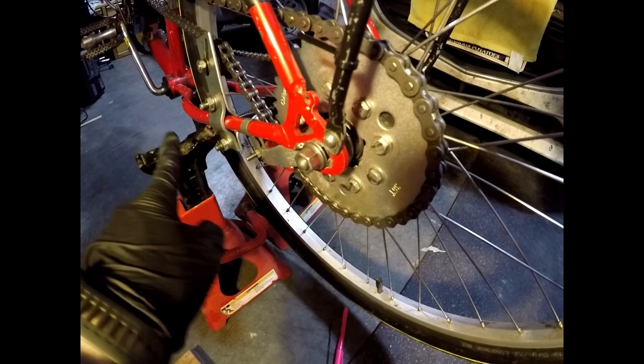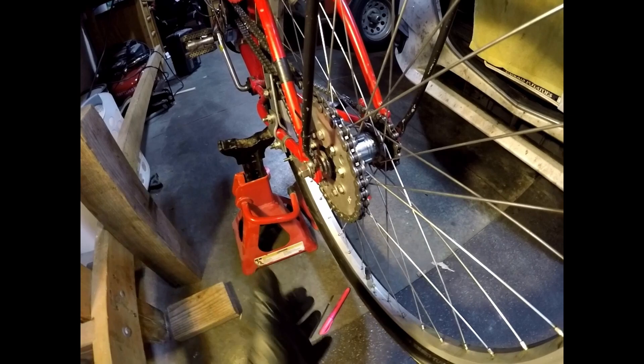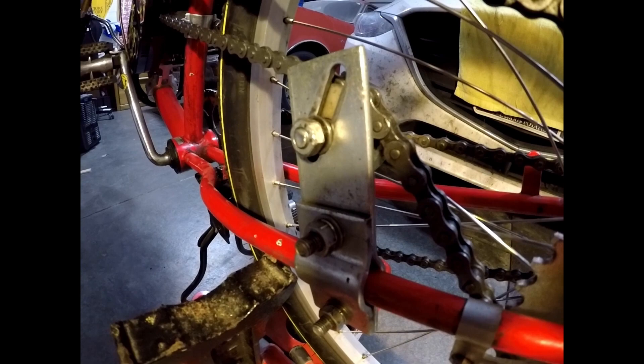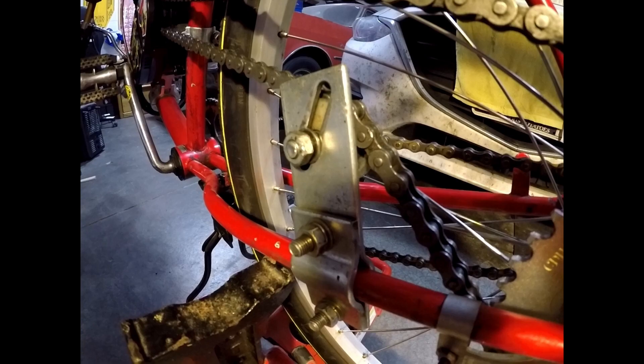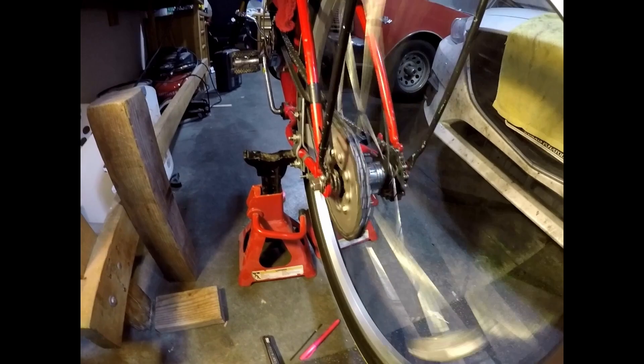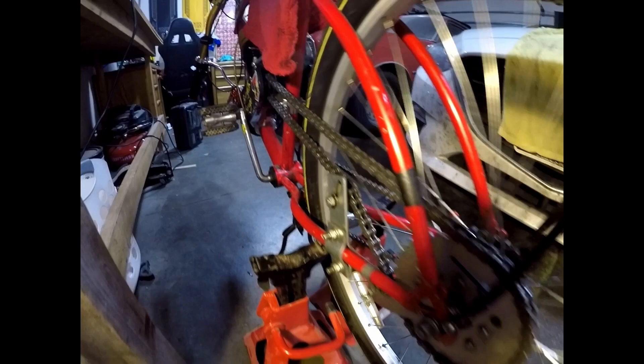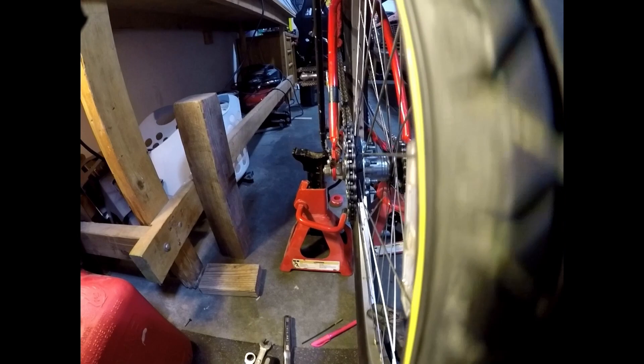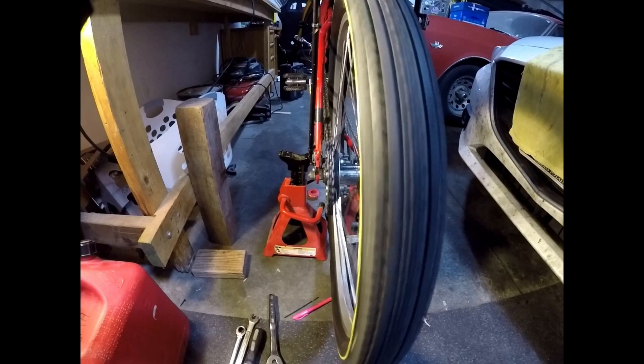Chain on. I have it on jack stands on both sides, so I have a little more stability, plus the tripod kickstand I always use for maintenance. It's not perfect, but it's pretty darn good — it's going to get us from point A to point B a little quicker. This is not the chain tensioner I'm going to use long-term; I'll upgrade to one of those moon-shape ones for more stability and overall control. It's turning pretty good, and chain alignment seems pretty good overall.